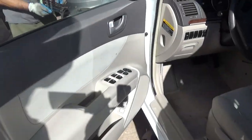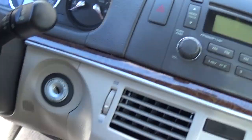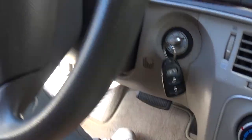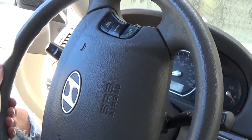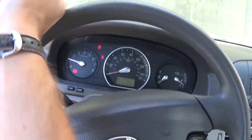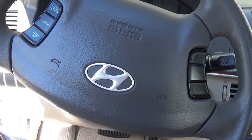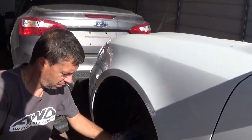To save you time and avoid going somewhere they'll charge a ridiculous amount of money — you need to go inside and turn the steering wheel all the way. On this one, turn it to the right. I'll go ahead and start it because of the power steering pump. Okay, just like that — that's good. Now we can access the brake caliper.